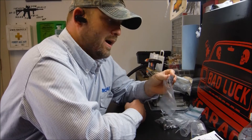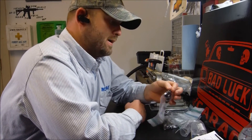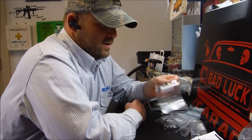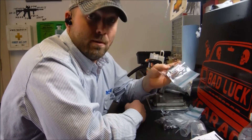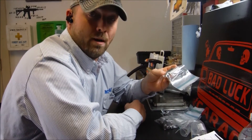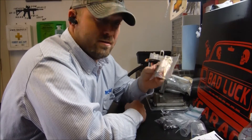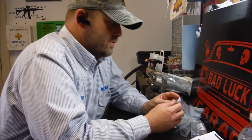116% is crazy. I hear people say all the time 'I run my injectors at 120%' and I'm like, yeah, but you get these things hot and one of them locks open — you're just pumping a lot of gas into your engine. But you get one that locks closed and it's bye bye. So I don't want to risk that.